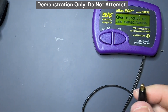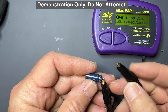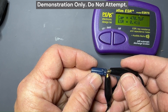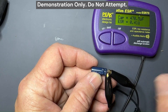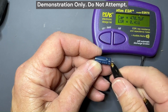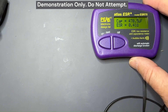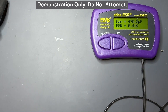Now this is a measurement of a good 470 microfarad capacitor — these are low-ESR capacitors for power supplies, so this should give us a good reading. It's reading 470.5 microfarads — this is a really good meter. And it's giving us a 0.41 ohm ESR, which means it's going to filter that AC out really well and provide a good strong current-sourcing capability for that 12-volt line. So I'm going to go ahead and install new capacitors on the board and get it in the refrigerator.